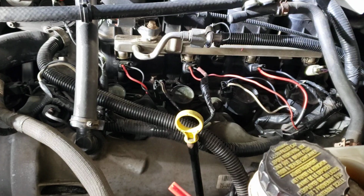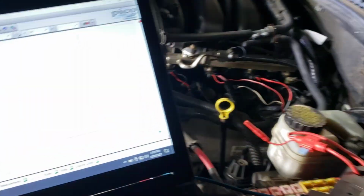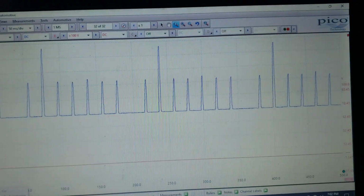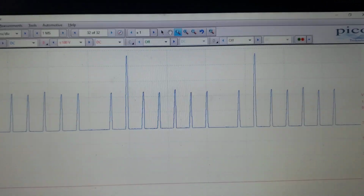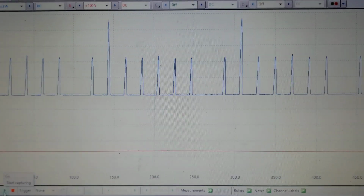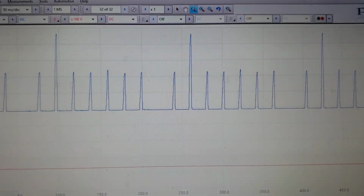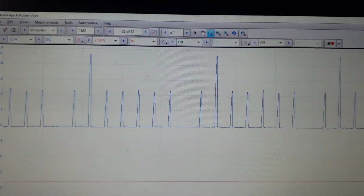So what I did was, from there, simply enough, current ramp, fuse 44, that's my feed. Oh, it is cold out here. So, something looks odd. I have one missing, and I have one injector that looks like it's pulling double the amperage, which is really perplexing.